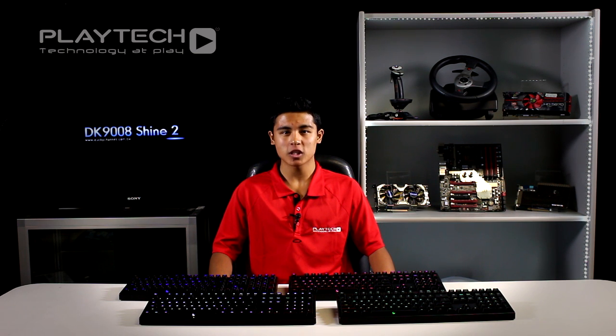If you're a typist, then I suggest you go for the brown or the blue keys because they give you a physical indication when you've actuated the key. Go for the blues if you want definite and clear feedback, and go for the browns if you don't fancy the click. If you want the best of both worlds, the brown switch is your best bet because it sits somewhere in the middle of all the switches and is a great hybrid for gaming and typing.